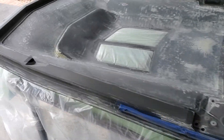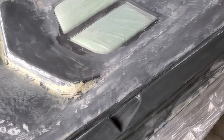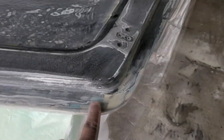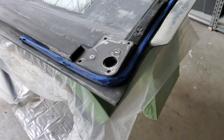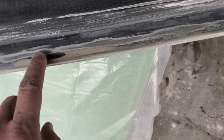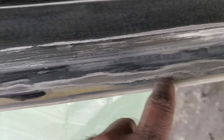We got it all down to 220, except for in these little areas. I have to get those by hand. The rest is just DA real quick because it's already pretty much smooth. So I just need to work on these corners, and then we'll be done sanding there. Then we'll be able to get filler primer on there. I've got a little dip right here, so I have to fill that in, and a little bit right there. But other than that, the rest feels really good.